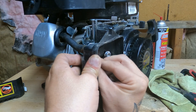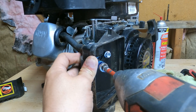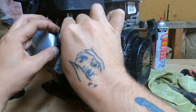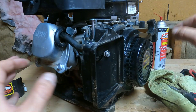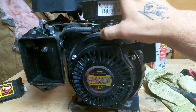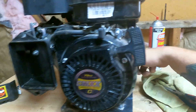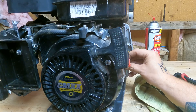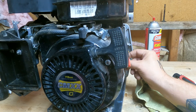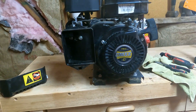With these water pumps, you don't want to run them too much without water running through them. So as long as they start and stay running for a second, you should be good to go. We will choke it — let me check. Make sure we throttle it up a little bit. Switch to the on position. Let's make sure there's oil in there. We got oil, so this thing should fire up.